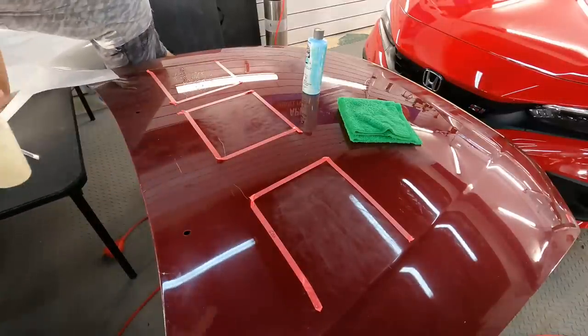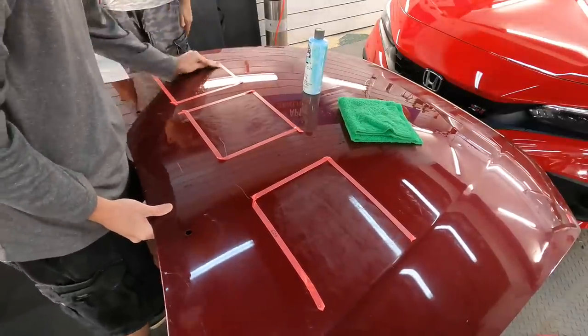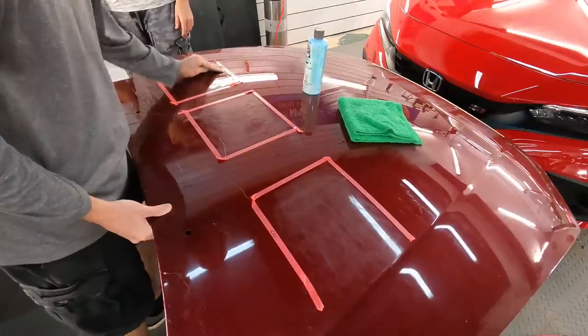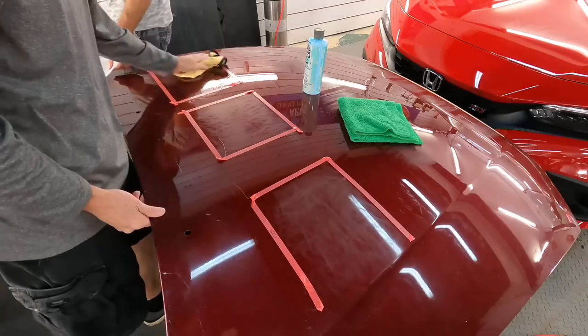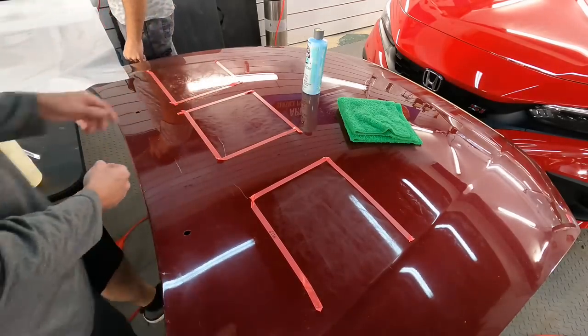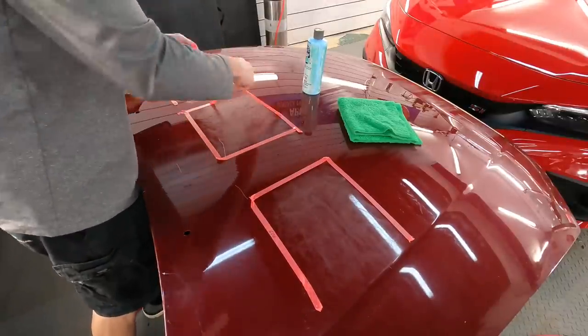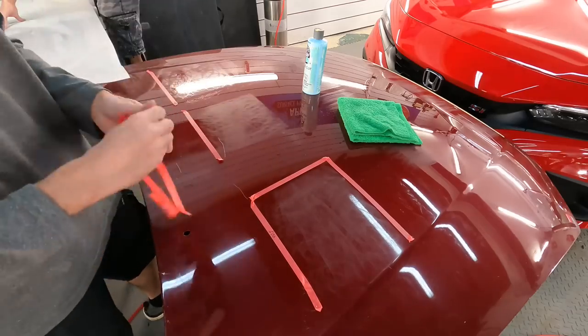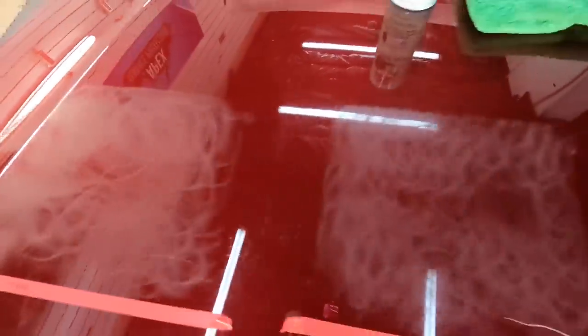For the most part you will need to finish down, especially on soft to medium clear coats, with a finishing polish and change out your pad as well. When we are working within the test area, we're going to keep an eye on the open time or cycle time, keep an eye on dusting if there is any, and we'll try the compound with different pads. The test area is prepped — 600 grit marks, which is difficult for a lot of compounds and pads together to remove, but we also have 1000 grit and 1500 grit areas.